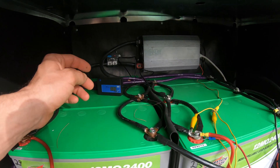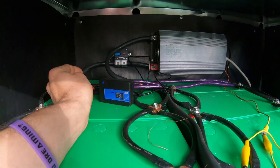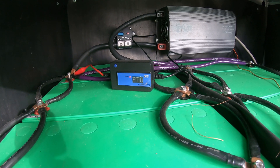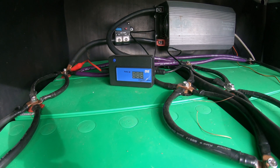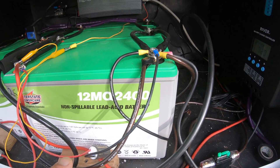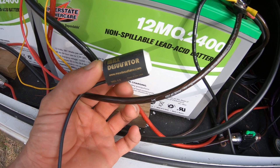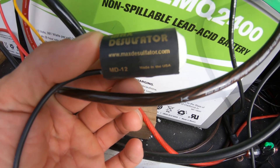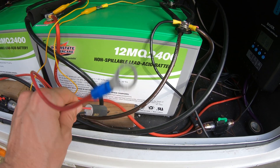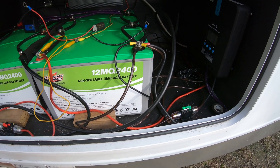One of the other gizmos you might have noticed here is a pulse charge battery desulfator. I got two different types and I move them around from battery to battery about every couple of weeks. That's a Green Power desulfator there, and this is a Max Desulfator right here. I actually talked to the owner of the company — he swears by these, designed it himself. Maxdesulfator.com. I'm not affiliated with them in any way, but they work really well. I have one on my truck as well. It just hooks up positive and negative and you leave it there.